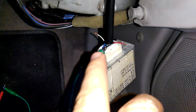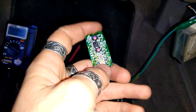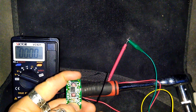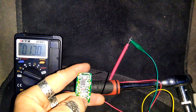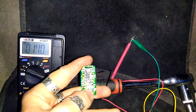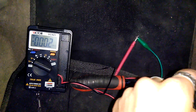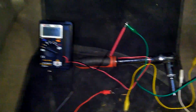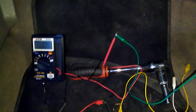So I soldered it and started poking around to figure out which wire is which. I now have three wires that have three functions not in the documentation but they do exist. The wire I currently have connected is exactly for this button. It's not straightforward — it doesn't matter if the car is locked or not. Watch my multimeter when I press it: it inserts 200 to 300 millivolts — just a brief small impulse, probably carrying some data. What you could do is make an amplifier to feed a transistor to power a relay, which would power something like an actuator for the trunk.